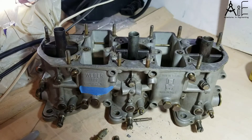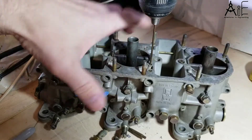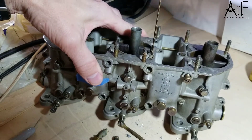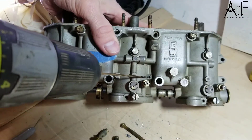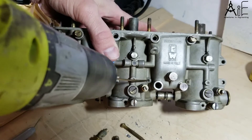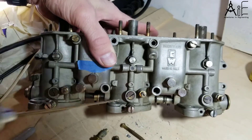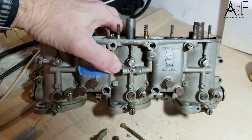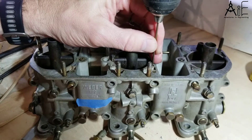I also bought an extra long 5/64ths bit for the same purpose, so I'm going to drill those out. Now, I don't know if this is bigger than these passages were originally, but the critical thing is the jets — these should flow fuel limited by the jets. So I'm not too worried about it being slightly bigger than before, but I definitely want to clean out all that crud that was in there.